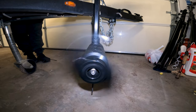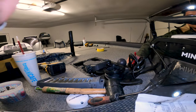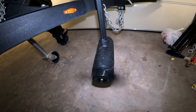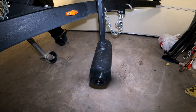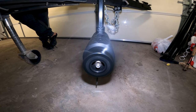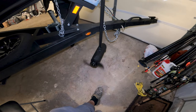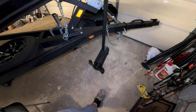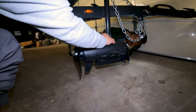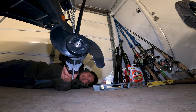It's still got a little rattle, but it's a lot better than before. Put on speed 10. Put on full max. Alright, speed 10. Go. Oh, that's way better than before. Go again. Yeah, it's way better than before. I mean, before, look, the whole boat rattled. Think it's good? That's what I told you. That's why I put a level on it. It may have a little wobble, but way better than before.